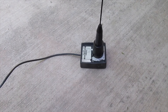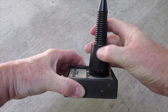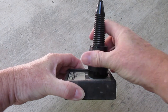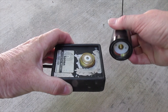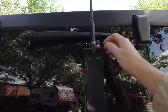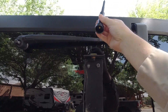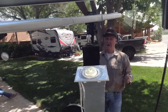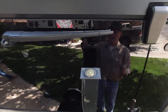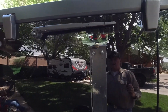The first antenna mounting system that I will cover will be NMO mounts. NMOs are the standard of the commercial and public safety radio markets. When properly assembled, NMO mounts are quite robust and should last quite a long time. NMO mounts will work well at either end of the vehicle. All that's needed is an area of metal that is parallel with the plane of the Jeep and can support a hole that is between 3/8 and 3/4 of an inch in diameter, depending on the style and brand of NMO. The trick with NMO is to figure out your mounting bracketry to obtain the horizontal plane for the antenna mounting surface.